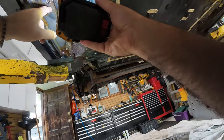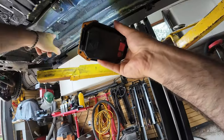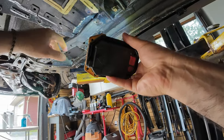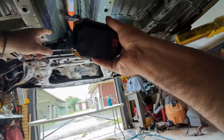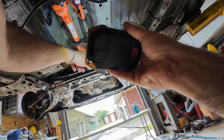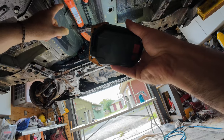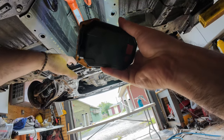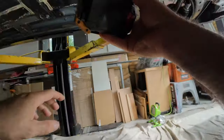I've hit these areas with the 700 to make sure the seams get treated, because 700 has a high creep rate. You'll see rust here, seam rust here. Now, this is the high-voltage cable — it comes from the battery pack. That's an area where you want to make sure you disconnect the 12-volt battery. You don't want to be spraying this. Even though with a 12-volt battery disconnected there should be no high voltage, you still want to be careful and exercise some caution.